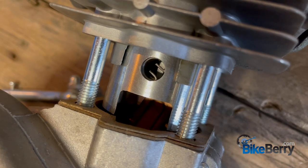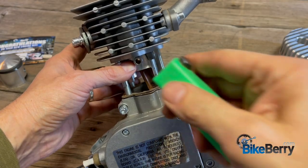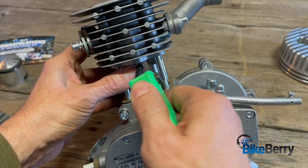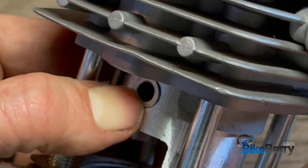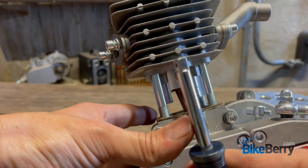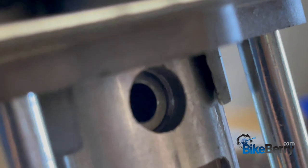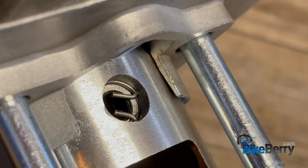If you notice on the other side, the clip is already in there so you won't be able to push it out. To work it in there, I like to take an Allen key and kind of wiggle it back and forth — that way you can start to push it in. Then you want to push it in all the way. You can use something like a socket driver because it's pretty safe and rounded until it goes in all the way. It's in far enough that you can see the groove right there to put our clip in, and it's touching on that side.